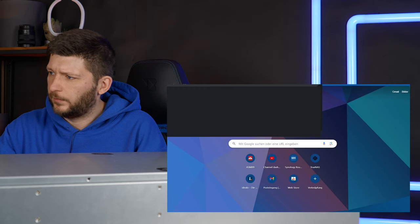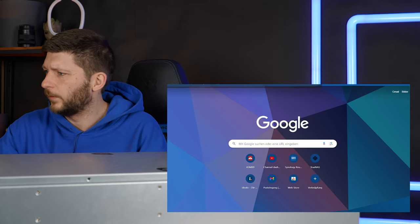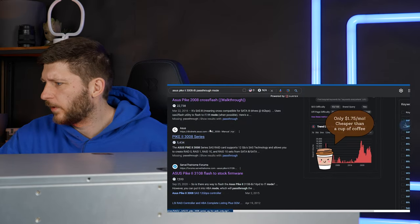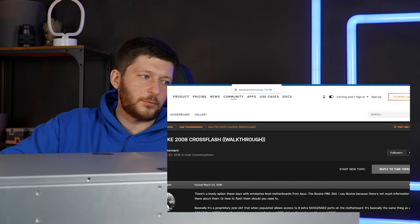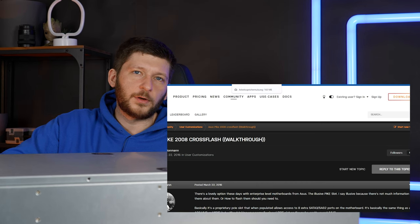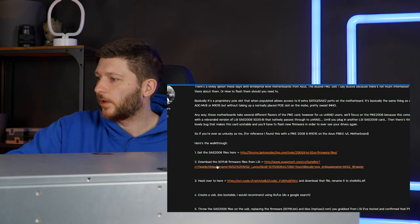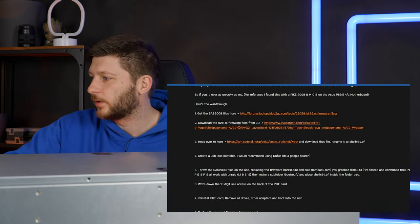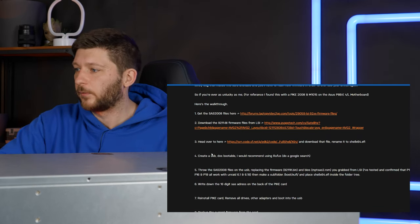Asus Pike 2 3008 8i pass through mode. No, this is something else. Because one of the possibilities I still have is just creating an army of RAID zeros or RAID nothings. Basically one disk per RAID. And then just access them that way. Or I could just RAID them. I mean, that is a possibility, but I wanted to do it through FreeNAS.